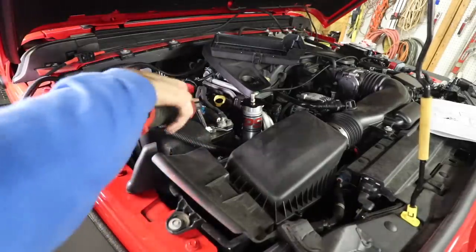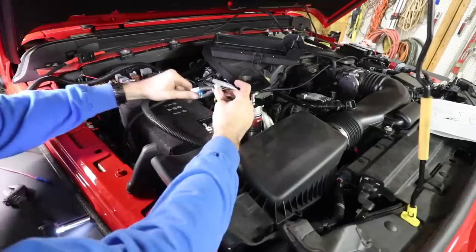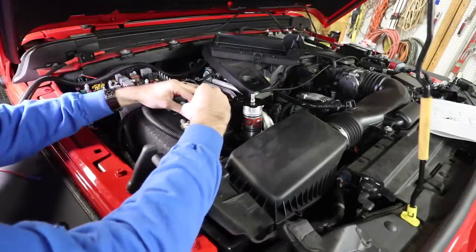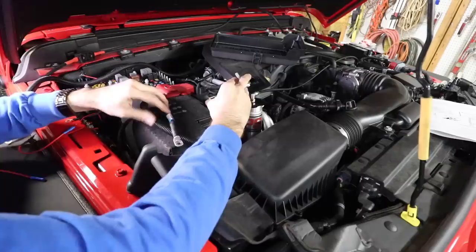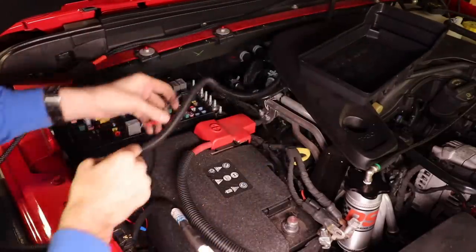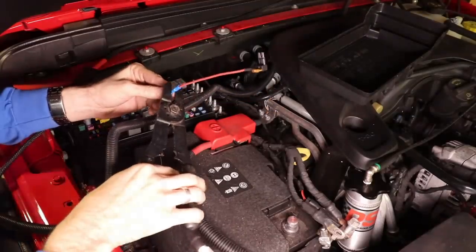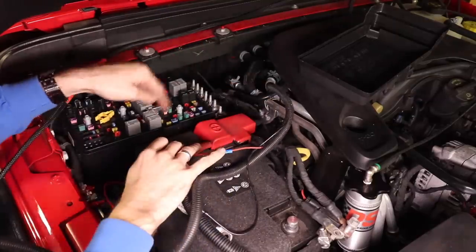When you're working on anything electrical, it's always a good idea to disconnect the battery. Remember that on the JL, there's two batteries — so you need to pull both of them. Not only is it confusing, but it's also two different sizes, which is silly. This is the second battery, which is underneath the fuse box down in there, and you have to pull it by separating those two wires. This is the winch, by the way — so you might not have that, but you need to separate this wire and this wire. In this fuse box, we're going to take that little red and black wire that came from the other side and splice this guy on it — it came with the kit. Just put that in there and give it a little squeeze. Now find F52 on your fuse box.